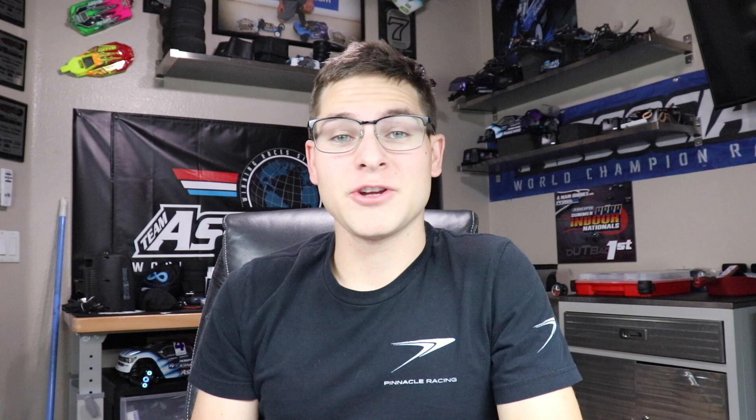That's pretty much all I have for you guys today. Hopefully I showed you what not to do when bleeding your shocks — having a bunch of rebound is not what you want. If you want your car to land poorly and have less grip, that's what you don't want. Having a dead, properly-built shock like I showed you — bleeding it twice — is definitely the most important thing to your car setup for creating grip, being predictable off jumps and landings, and most importantly you'll have a better time out there on track. Thanks for watching — if you like the video drop a like, subscribe if you haven't already, and until then we'll see you on the next one.